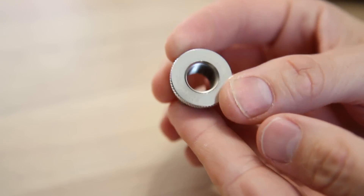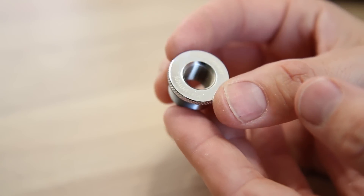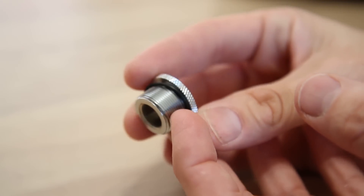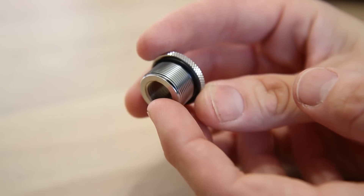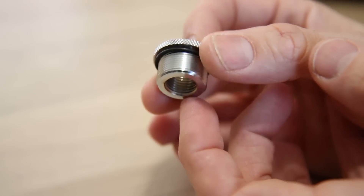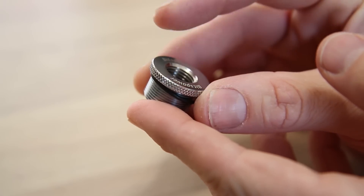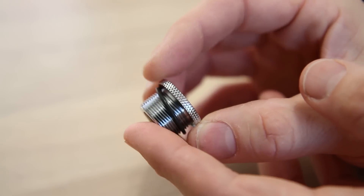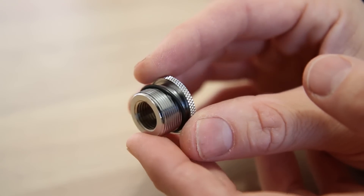This is what the fitting looks like — it's very simple. It's nothing more than an inner and outer threaded barrel with a collar, which keeps it from falling through whatever surface you set it on. It's got an O-ring in there, and that doesn't do anything for sealing fluid — it just holds the item in place so it doesn't spin, because you do put a fitting on each end. The inside is threaded for G-quarter thread, which is what pretty much all fittings are. There are also G-3/8s, but pretty much all water cooling stuff is going to be G-quarter thread.